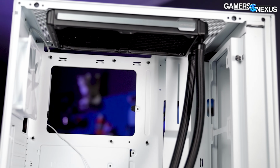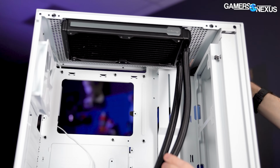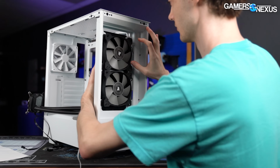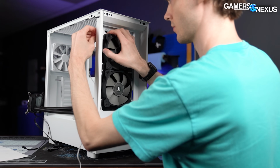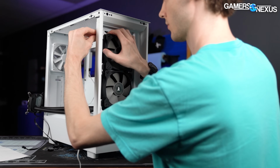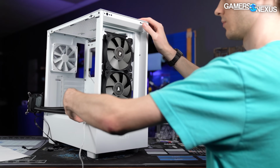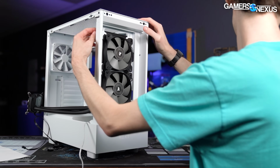But the top mount is offset from the motherboard, so it avoids clearance issues. The top-mounted coolers will still overlap the motherboard a bit and make it harder to access, so the front mount is really preferable here for an AIO. Installing a standard front AIO requires installing the fans in between that very front panel and the outside of the chassis, so it's still in the case. It's just between the two. And then you would put the radiator on that mounting bar in there. So that allows for a 45mm maximum radiator thickness as listed in the spec sheet.